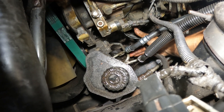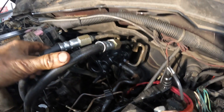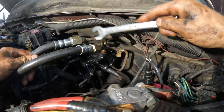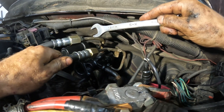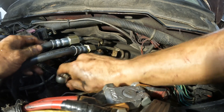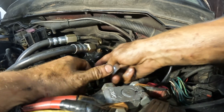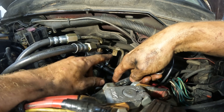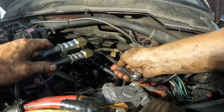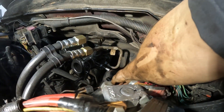This pipe right here goes down — pretty good access to tighten that in with a 20mm. I need to get these lines correct. I didn't yet tighten this fitting and this fitting because I needed to be able to twist this hose for positioning those lower tubes. So now I'm going to tighten one at a time. This positioning is not hyper important, and you don't have to tighten these too much because they're O-ring sealed — as soon as you start to contact, you're not leaking.